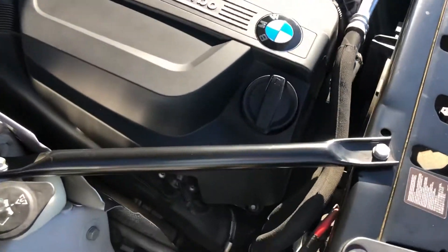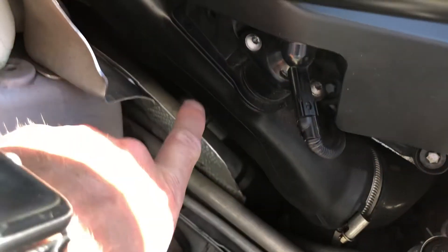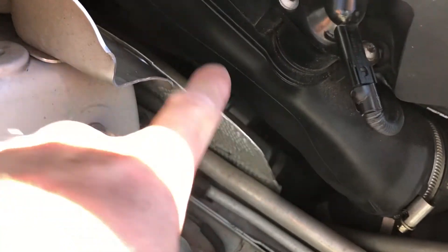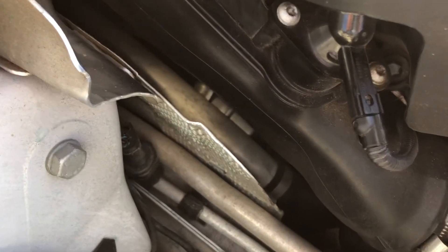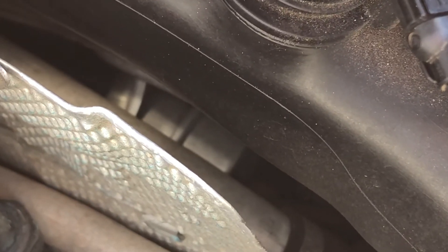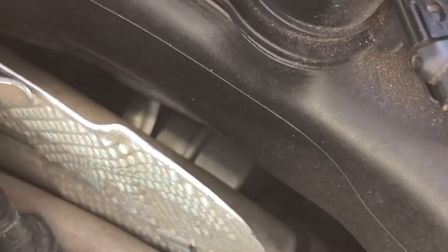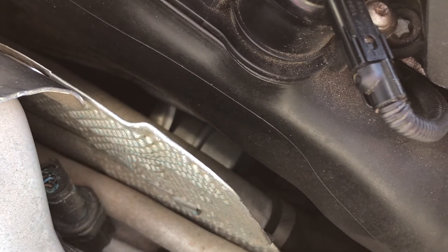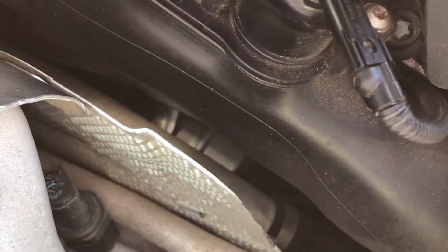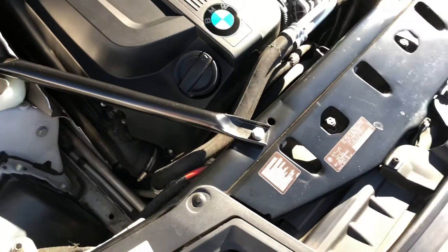You want to get to the passenger side of the car right here, and then look on the side of the engine bay. You'll see there's a heat shield, and right behind the heat shield there is a pipe, and underneath that pipe you can see there is a cylinder-looking thing — that is your pneumatic wastegate. In my case it is PWG. If you have EWG, it'll be just a rectangular black module mounted in pretty much the same location.